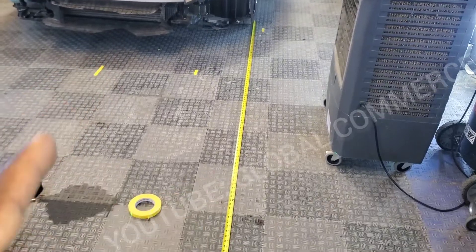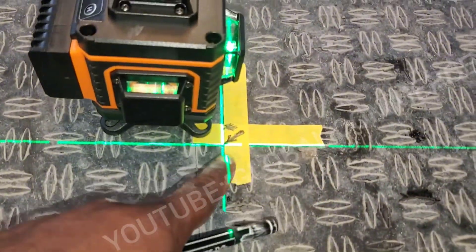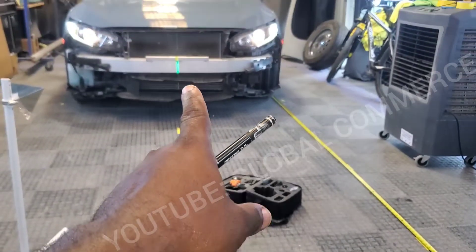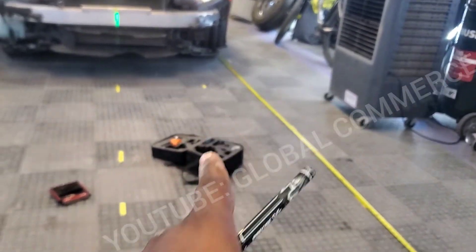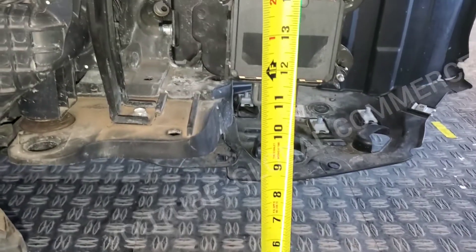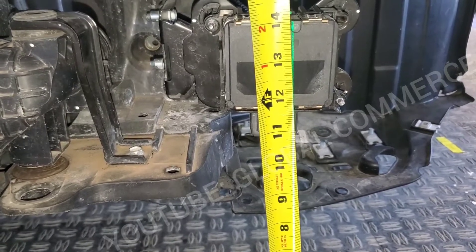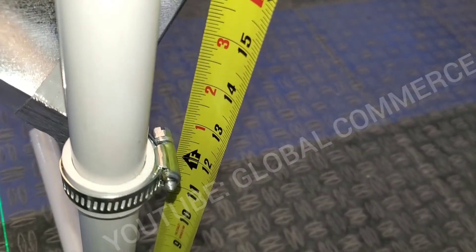And of course you're going to take from your center point to this distance as well. So this is our center point — 4,000 millimeters out from the center point of the car, 4,000 millimeters, which matches there at 4,000 millimeters from the front tire center point. Because I know my radar is in between this space — it's on the driver's side. So I got the tape and I put an arrow to designate where the line is on the outside of the tape. That's the right distance at 4,000 millimeters. I'm going to get my height from the ground to the center point of the radar, which is right about 13 inches. So I know where to put my target height roughly — center of my target at roughly 13 inches right there.